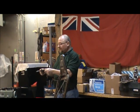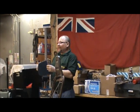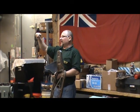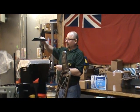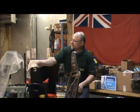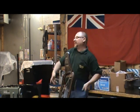I've already dealt with some customers that said, well, I got up there with a staple gun. Well, up underneath there is actually a fiberglass board or a light pressboard that's molded. Now to replace this part, you have to take the trim off around the outside, flip it upside down on the big table and pull this old stuff off, get in there with a wire brush, scrape off this old foam that's now all just mush, put this new stuff on, glue it on, smooth it out, and then put it back up.